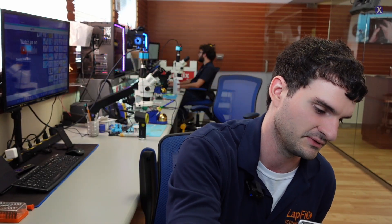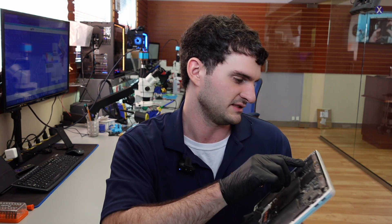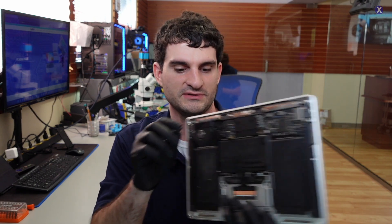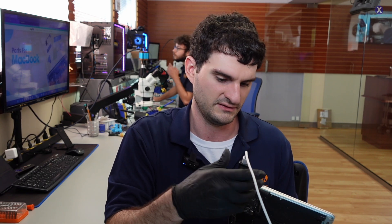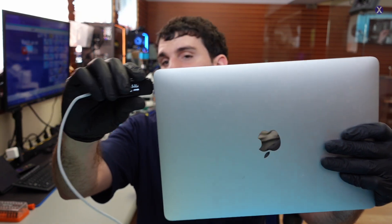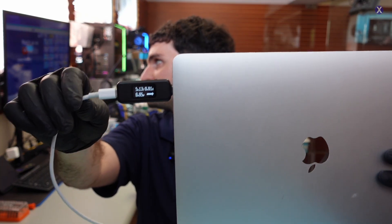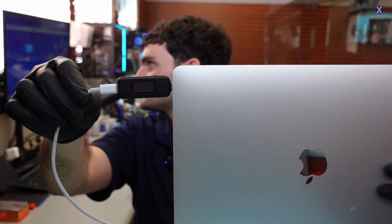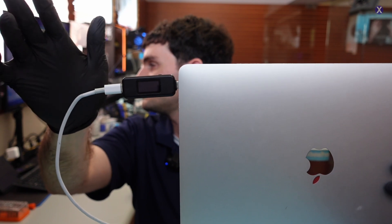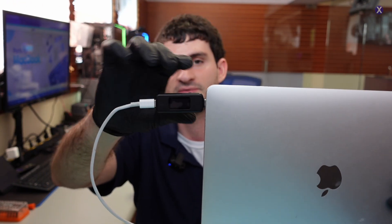Let's go ahead and take a look at what's going on. We plug it in — we don't see any obvious damage here, but I believe there was a liquid spill. We took out the battery connection just to see what's going on. It feels like something's jammed in the port actually. It's still showing 5 volts, 0.1 amps. Moving to the other port — this one also feels a little bit jammed, like something's in there. Doesn't go in all the way.